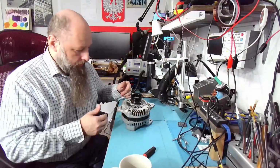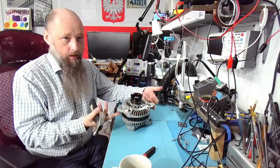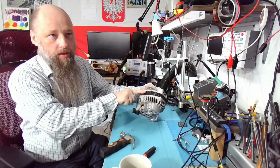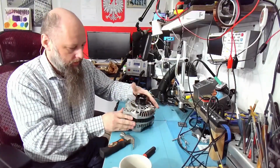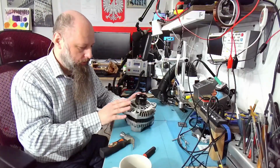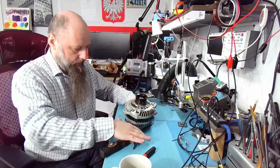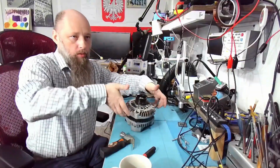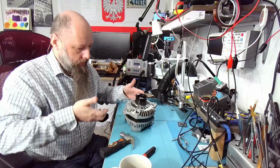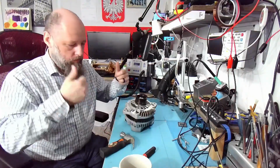The screws are out. Now, what I do, I just take a little hammer, and we're gonna hammer a little bit from this side until we see this here separating. Once it's separated, all you have to do is just pull it and it comes off. There are tools designed for opening these. It's basically a clamp, and then you pull it from over here, on the kind of a reverse press. Or you can place it in the vise and pull it as well.